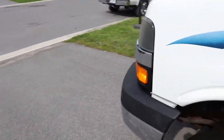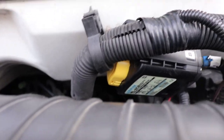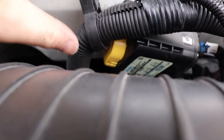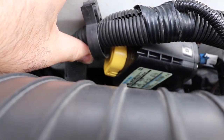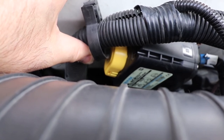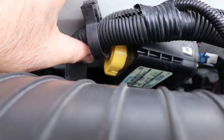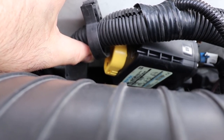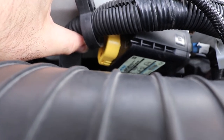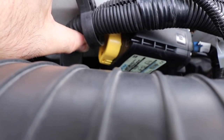All you do is turn on your vehicle and you have to wait a specified period of time for the battery voltage to come up, and you'll see this is going to click in. The beauty of this is there's no voltage drop across any diodes or anything, so your coach battery in the back is going to get full battery voltage. That voltage was high enough for whatever length of time, so that tells the relay to close. After I turn the vehicle off, it's going to open when the voltage drops, so you'll have your batteries linked together.